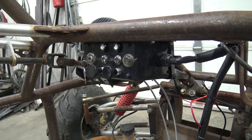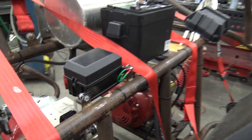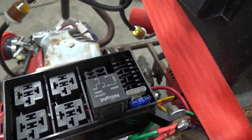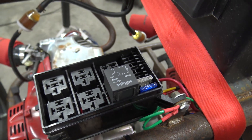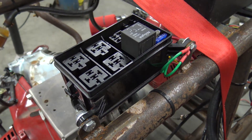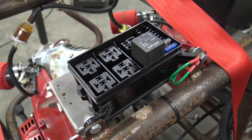If you want to kill a single engine, you can't do that with the way I wired this — one key switch kills both engines. The harness goes back to this relay and fuse box. We only have one relay, and that's for the headlight. Then we have two fuses: one is the headlight fuse, and the other is the accessory fuse, so anything running off the key accessory hot is fused there. We used a big box so if we ever add more stuff like a winch, we have all the wiring ready to just wire up into this box.